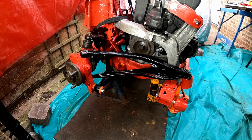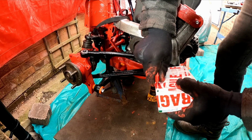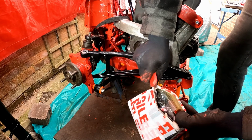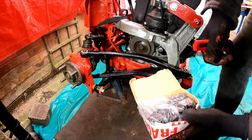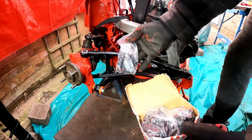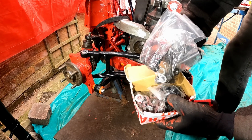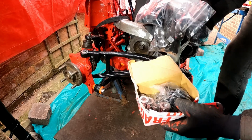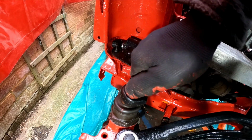Although, just as I was setting up out here, this turned up from eBay. Yes, that will do. Here we go. So, there was no sense in buying literally two nuts, one for each hub. So I took the opportunity to just stock up on a few, and somewhere in here we do have some new washers as well. Somewhere in here we have M12 1.25 pitch nuts, which hopefully will fit perfectly. Let's try this one. Yes, yes, yes, I think we're probably in business with that.